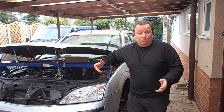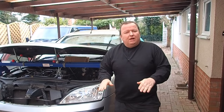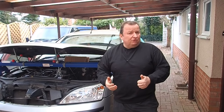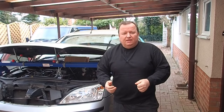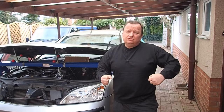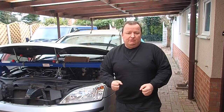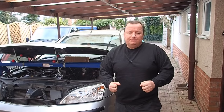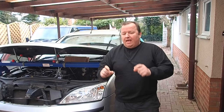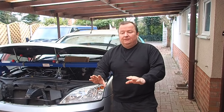So I've torqued up all the bolts for the steering arm and the anti-roll bar. On the lower arm you've got the front and rear bolts that need tightening, and they also have to have thread lock on them. The front ones are 59 foot pounds, then you take the torque wrench around a further 60 degrees. The lower arm rear bushes are 66 foot pounds, also with the 60-degree tighten. The clamp bolts for the anti-roll bar are 35 foot pounds.